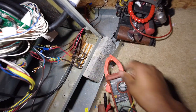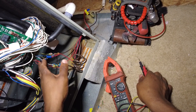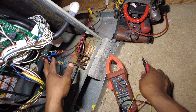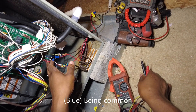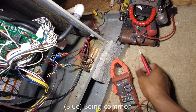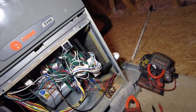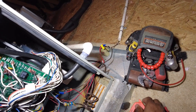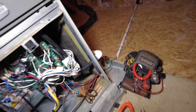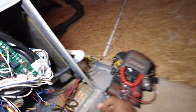I've already tested to make sure I was getting — I had my thermostat calling for a fan. Made sure I was getting voltage between G and blue, and also R and common. So we're getting voltage there — it's definitely calling. Next, I'm going to perform the go/no-go test, as they call it.